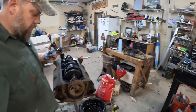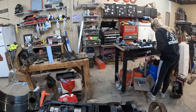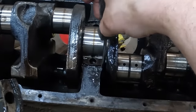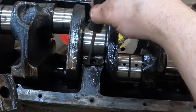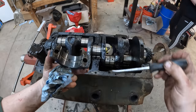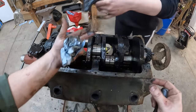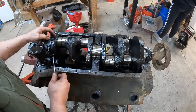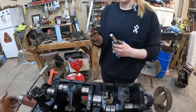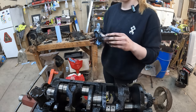So here, this is why we're having a little trouble getting it with a hammer, because there are corresponding half moon grooves in the block here that correspond to these guys here, so that those can't move left to right when they're locked in there. That explains that. But should I have marked them though? Lift out of here now.